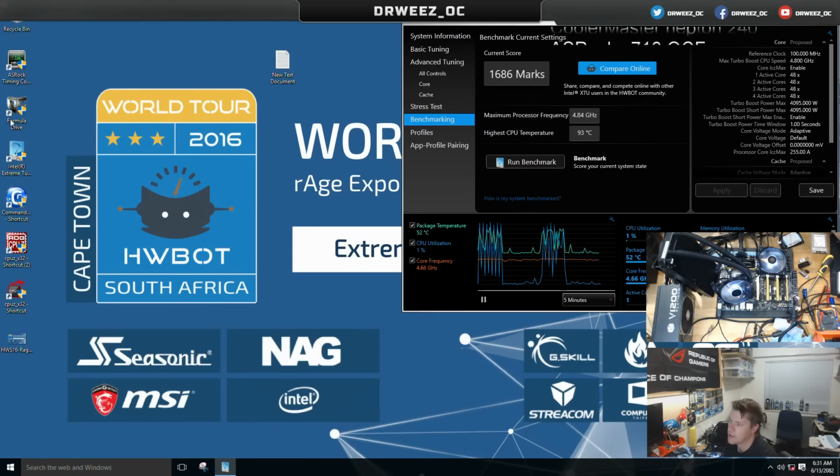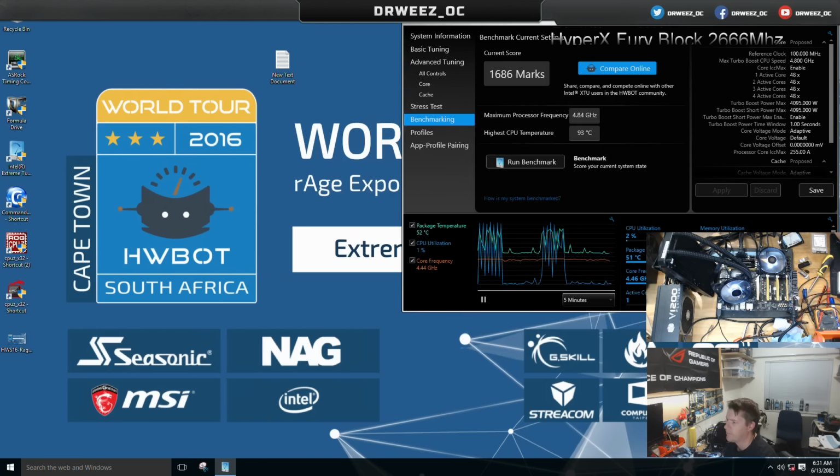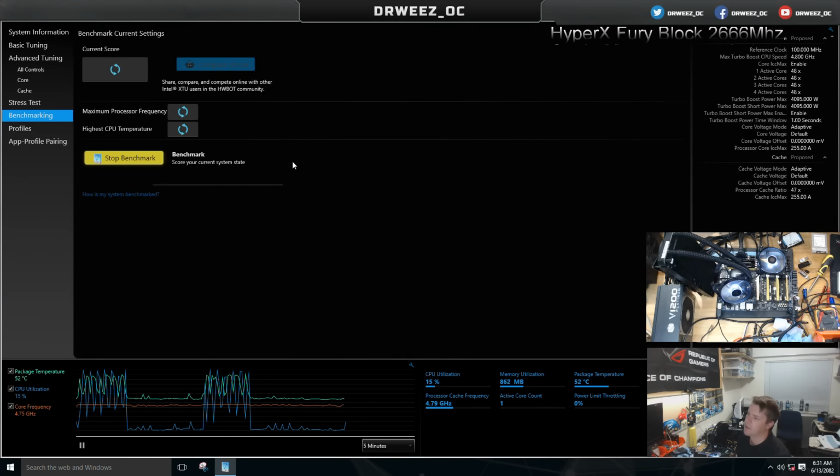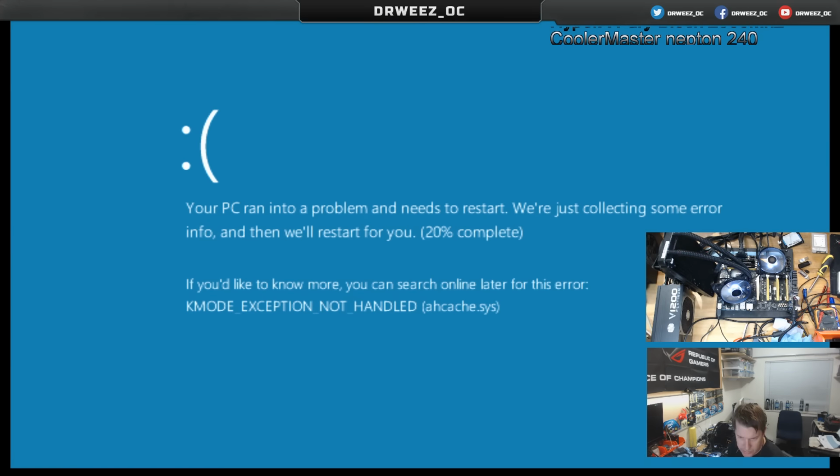Okay, so what we do again is increase the base clock another point further and try again. I don't really like to go up a full base clock at a time, but you know, I'm doing it. Apply and just run it again. And you basically just keep doing that until the such time you blue screen. And there we go. Alright, so that concludes.